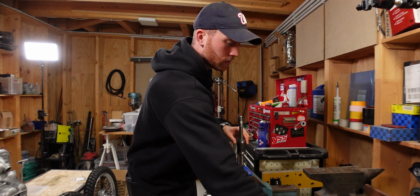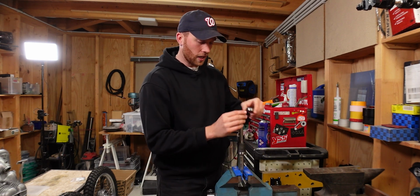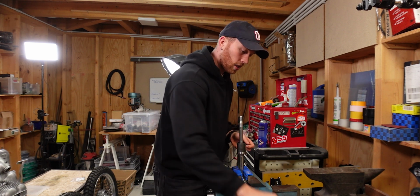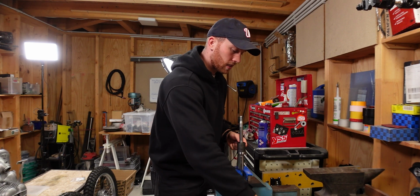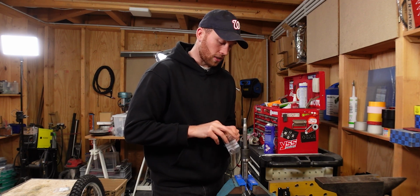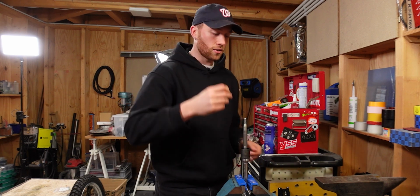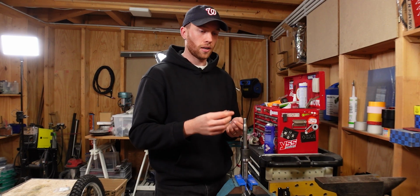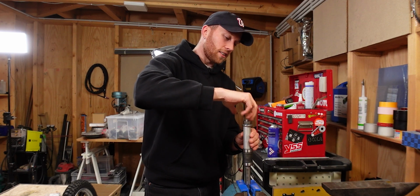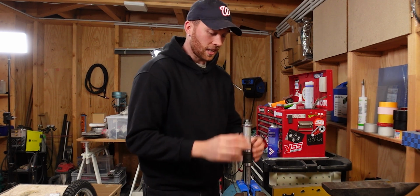So we're just going to use the 2 bigger ones that I ordered and test those on the rear axle right here. So old shim goes out, and then I'm gonna test the next bigger size. And I unfortunately only read the part in the book after I ordered these, so I skipped the first increment and went straight to the second largest, so from 6.55 to 6.65 now. But let's see how that works. Sometimes you just have so many things in your head and you do 3 things at the same time, and then these things happen.